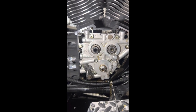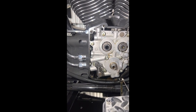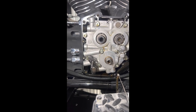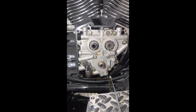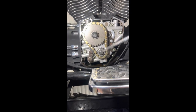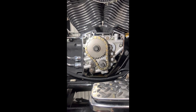So we've got our cam plate and cam install, everything back in there, lined up. We have now put the tensioner back and located it so there's no tension. We will get our new chain on for the pinion gear that goes up to our camshaft end gear here. We'll get that organized — still got to pick this gasket off, but we're getting there. Behind this washer, we have got a dot on this gear. So on the cam plate, your dot connection needs to line up for the timing. Keep an eye on that stuff when you pull it apart. We've got our tensioner on, our new chain, our guide's in — I've got to get this gasket off now, redo that, and then get on to the next bit.